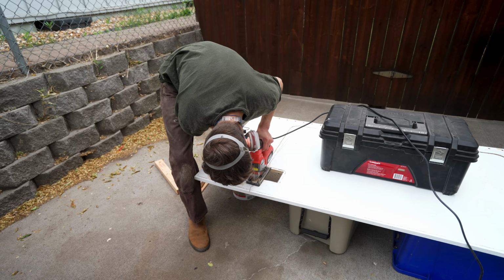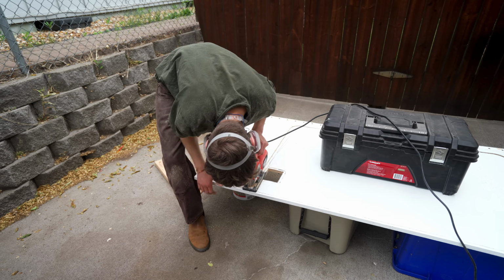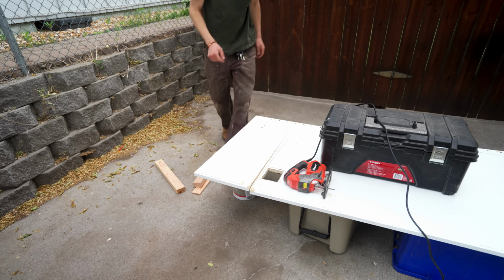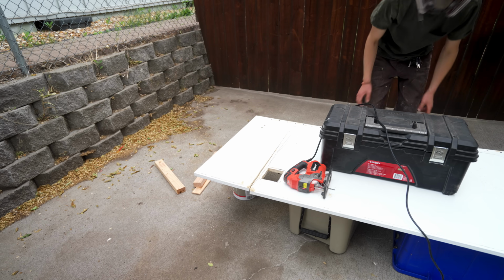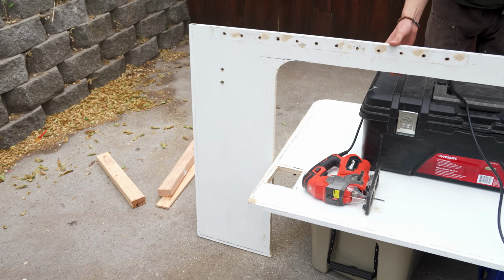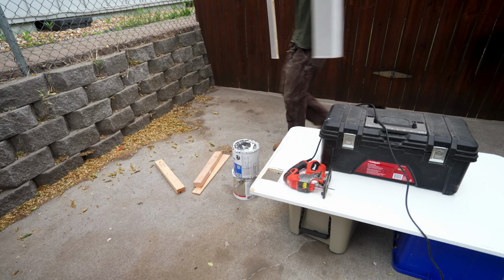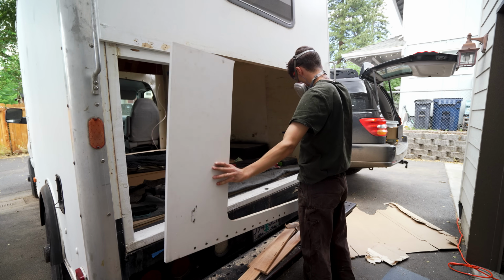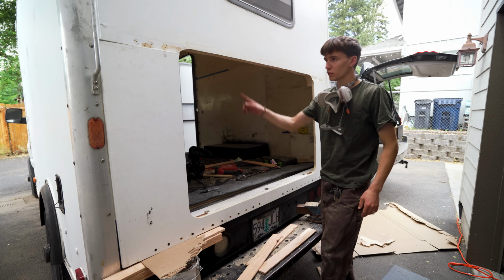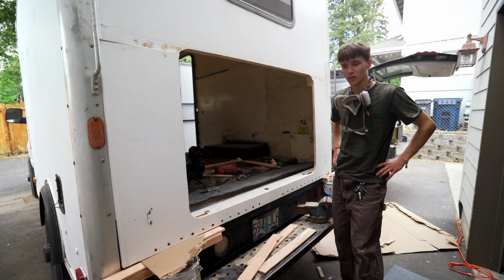new one. The width between the two holes I had previously cut out for the slam latches was around 46 inches wide, and the new RV compartment door was 48 inches wide. This meant those two holes would be included in the centerpiece I was cutting out. None of these modifications were planned, so all I can say is that I got super lucky here. If the handles had been just a few inches farther apart, I probably would have had to make an all new sheet of plywood.